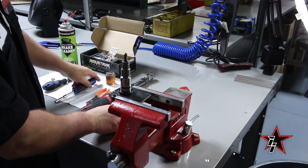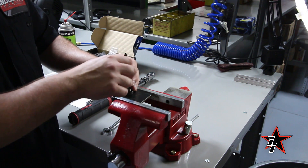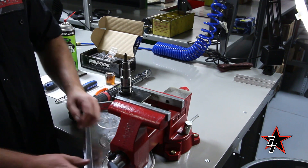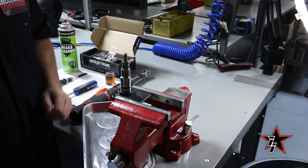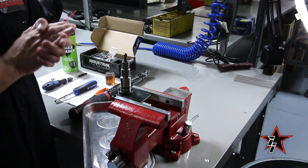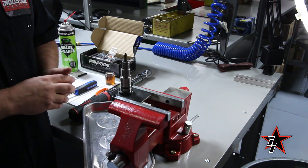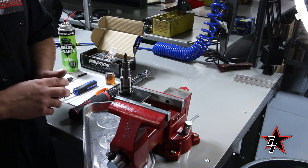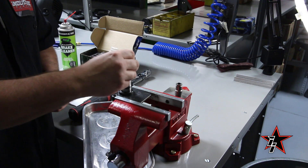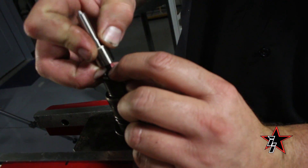Applying downward force ensures that carbon stuck between the nozzle and the cap doesn't cause the nozzle to turn as you break it loose and shear the pins off. Before pulling the cap off, I always like to have a magnetic tray so if any parts fall out they land in it. The new style has much smaller parts that always get lost — most people don't realize those parts can stick to the bottom of the nozzle. That part is critical to how the injector operates and it will not function without it. I tilt the nozzle sideways until I can get my finger in there and push down to make sure no parts are stuck to the nozzle.